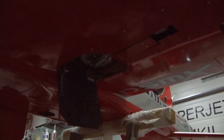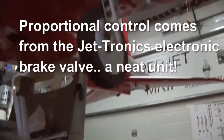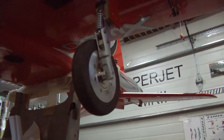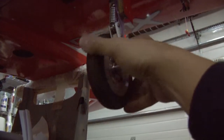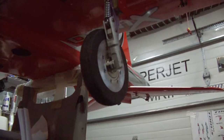Going back to the retracts — I'll put them down. The brakes are proportional. You can see the brakes spin here. The first stage of braking is on but the wheels are very easy to move. Give it a little more and they get pretty hard to move. Take it all the way down to the bottom and it gets real hard to move. So they are proportional.